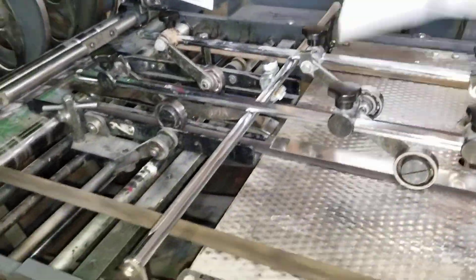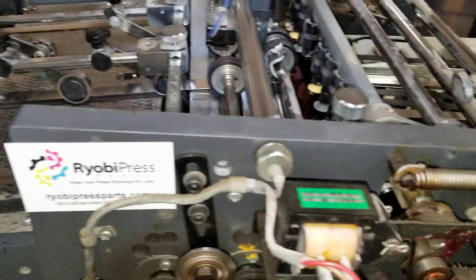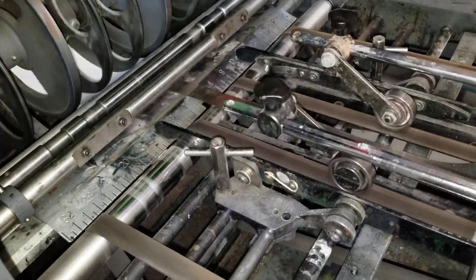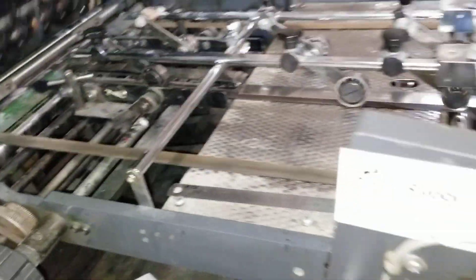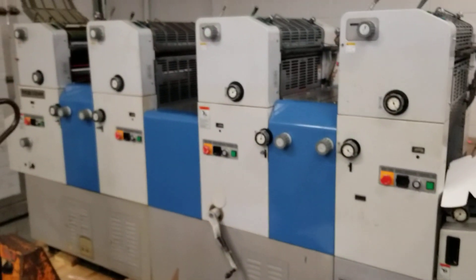Now I've got a jam up, of course. She comes down and sits for a minute, the foot guy comes over — exactly what it should be. So the chain was off by three teeth, and that's how you check the timing and fix it on the 3302, 3304, and the Ryobi. You do the same thing on that machine.